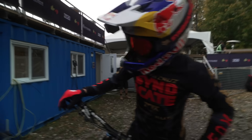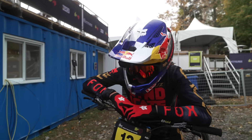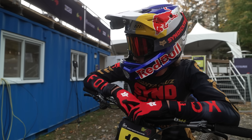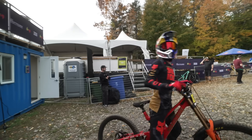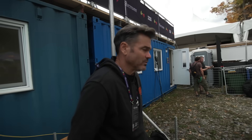Let's call it a day. How are you feeling? I wouldn't say I'm feeling 100 percent, but definitely a lot more control - opened up the taps in a few sections and it was just going where I wanted it to. Getting pretty deep in the travel. Maybe we chuck on one more low speed compression click. Let's do another run and then maybe firm up the fork a bit if he's feeling ready for it.